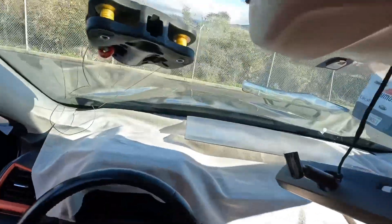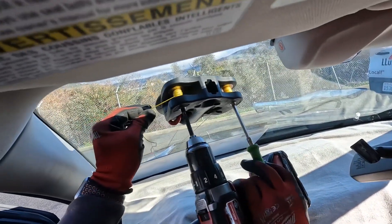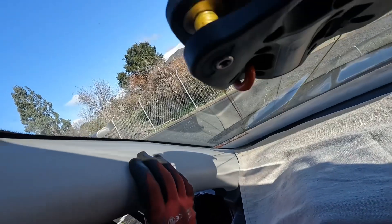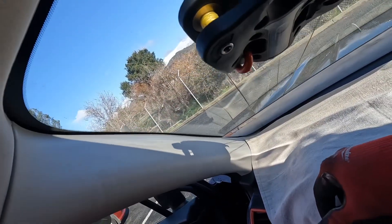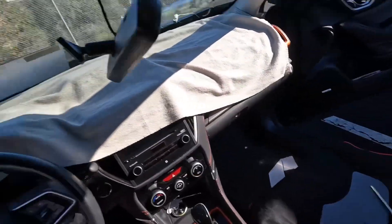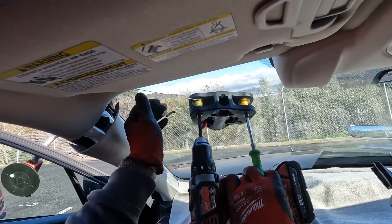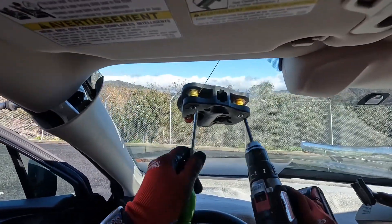Pull up your slack, drop inside here, put our guard there, grab our drill and our drag and start cutting. Another option: if you don't want to damage these pillars, or if you have a situation with a Volkswagen, Chevy, Audi, Dodge, or some of the others where this gap is really tight and you run the risk of cutting the pillar, just pop this loose so it hangs down a little bit like that, and then you don't have to worry about it at all. Leave that like that — drag and drill.